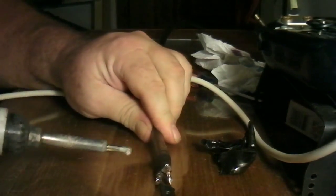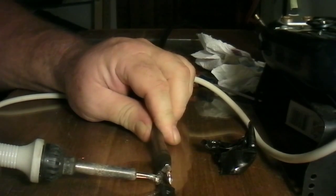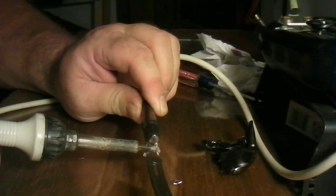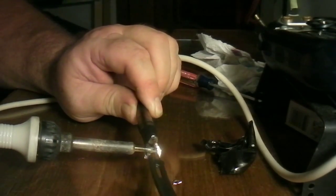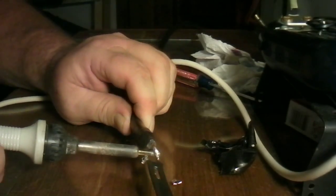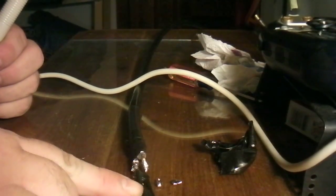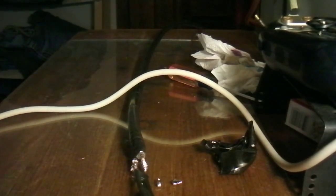Moving the green part of the antenna — the top part — wasn't working, so shortening... I'm going to move this. This one part is the ground — it's behind this. It was not right. So when I get that unsoldered I'm going to move it about a half an inch, because it was way off. I soldered it up higher, trying to make it shorter, and then taped it and soldered it. There it is. I got to tape the other side, then I'm going to try it.